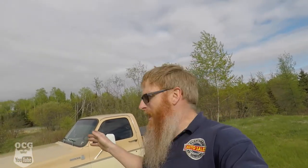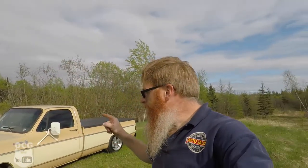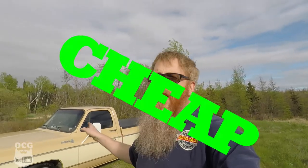But let me tell you a little bit about those wheels and tires. Obviously, I just said American Torq Thrust 2s. And the tires that I used up front are just cheap tires. I have a hard time paying big money for big name brand tires. I'm thrifty when it comes to that. So I went with a tire called Ovation, and these are the EcoVision. Up front, I went with a 225-55-18, and they are 18 by 8s up front. And in the back, I went with 255-60-18, and they are 10 inches wide in the back.